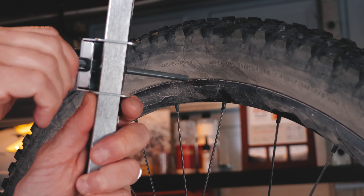Once you've got an equal amount of gap between the pin and the rim on the front and rear, rotate the gauge around the rim and see if the gap is about the same all the way around. Keep that pin in place and check at various points — the gap should be consistent all the way around. It doesn't have to be perfect but it should be close. This one is about an eighth of an inch wherever I measure it and I'm happy with that.